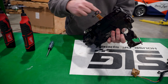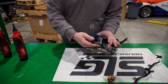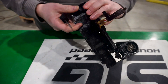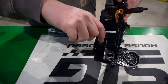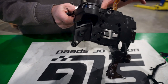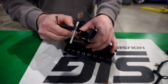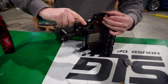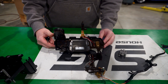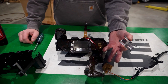They're not going to be reused, so just don't cut into the cover too deep. At this point, take it over to a blow gun and blow it off to get the plastic off. The next step will be to pry open the cover and this whole top will pop out. We got our mechatronics cleaned off, no more plastic. Basically, you want to start right here, get a nice thin screwdriver and just twist it, working all the way around while maintaining everything because there are quite a few clips that will want to relatch as you go around. So that cover comes off. You'll have a bunch more oil underneath — try to send them to us as dry as you can so they don't leak in the box. This piece will no longer be reused; it can be thrown out.